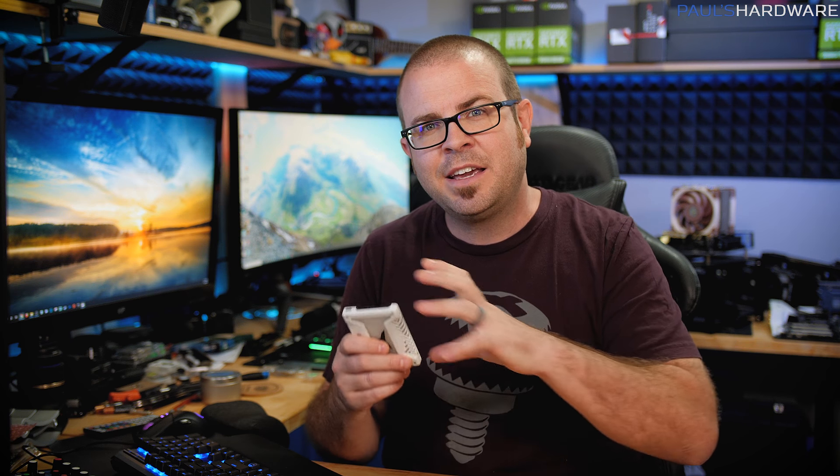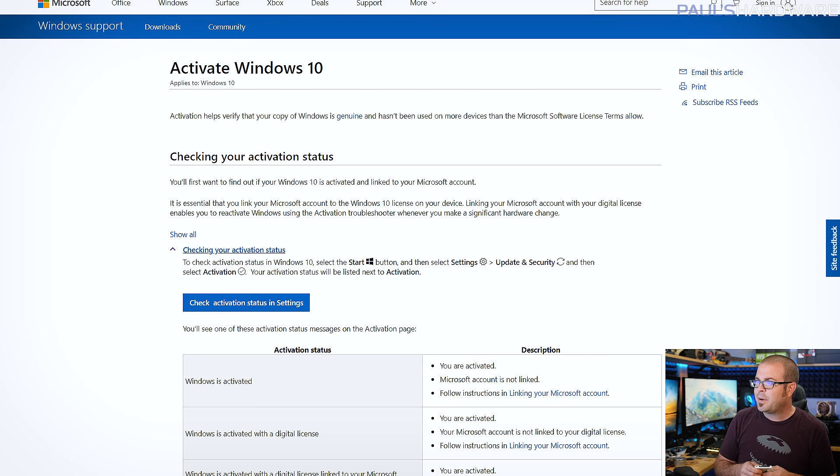Second part of your question: can you take that Windows 10 installation from an existing computer and move it to a new computer without wiping the drive? The answer is yes, you can, but there are some things to keep in mind. I usually like a clean fresh install when doing a new build, but Windows 10 is more flexible than older versions. It should recognize the hardware, use Windows Update to download drivers, and get the system up and running. Loading into Windows 10 though is not the same as having it activated.